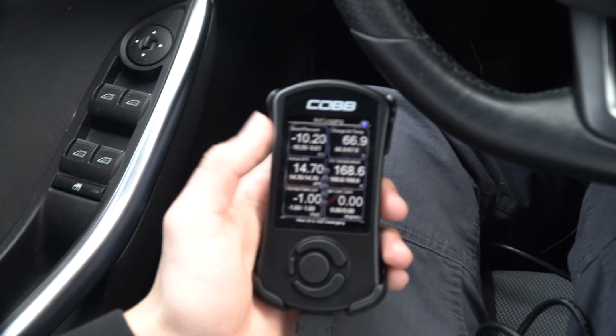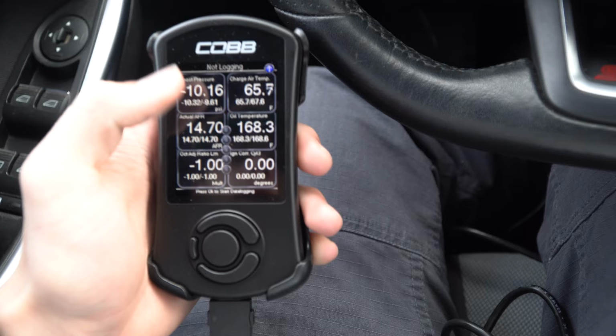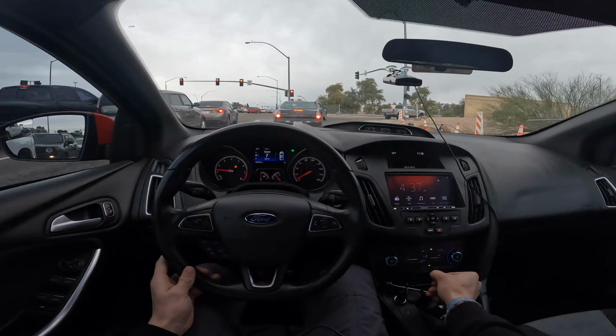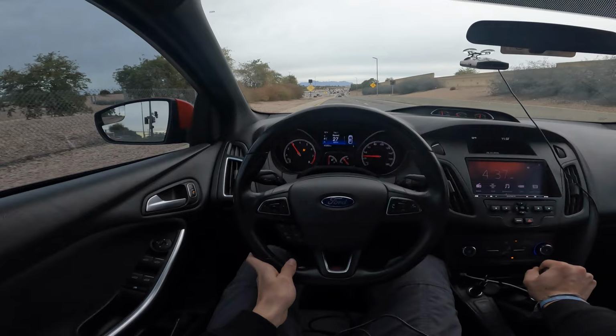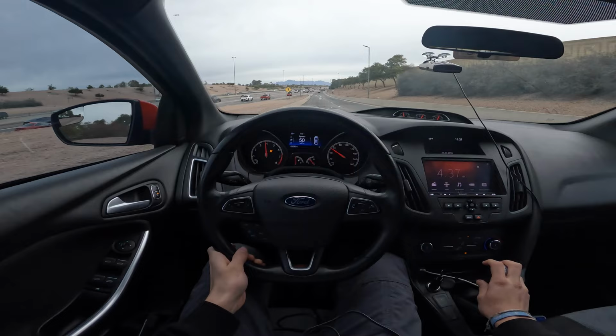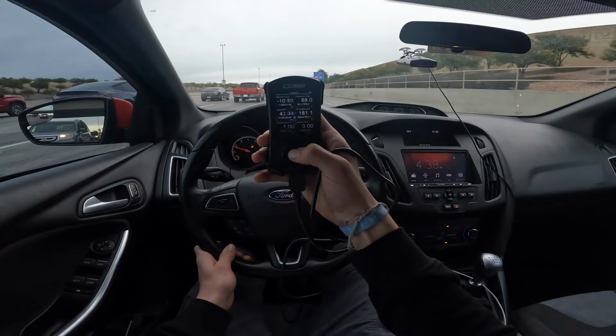The next day. Now that I have all the things listed on here that Alan wants me to look for while doing the pull, and everything he wants me to log is all set, now we're gonna go do a pull between 2500 and 6000 RPM wide open throttle, and we'll log it. I think nobody's behind me waiting for me. About 25, full throttle. Alright, all the way to 6K. I should have got it, so I'm gonna stop it now.